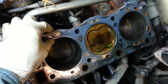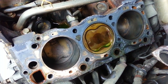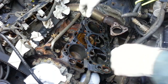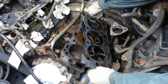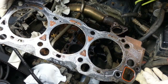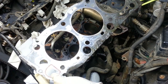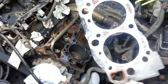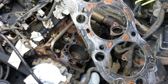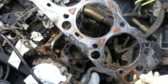We'll need to peel off this head gasket and take a look under it and see if we can see some evidence of where that coolant is coming into the cylinder. To be honest, I'm not really sure what I'm looking for. I was hoping to find some kind of evidence where we had a failure on this gasket between the cooling passages and the combustion chamber, but other than a bunch of gook built up here on the bottom, I don't really see anything that I recognize with my inexperienced eye.